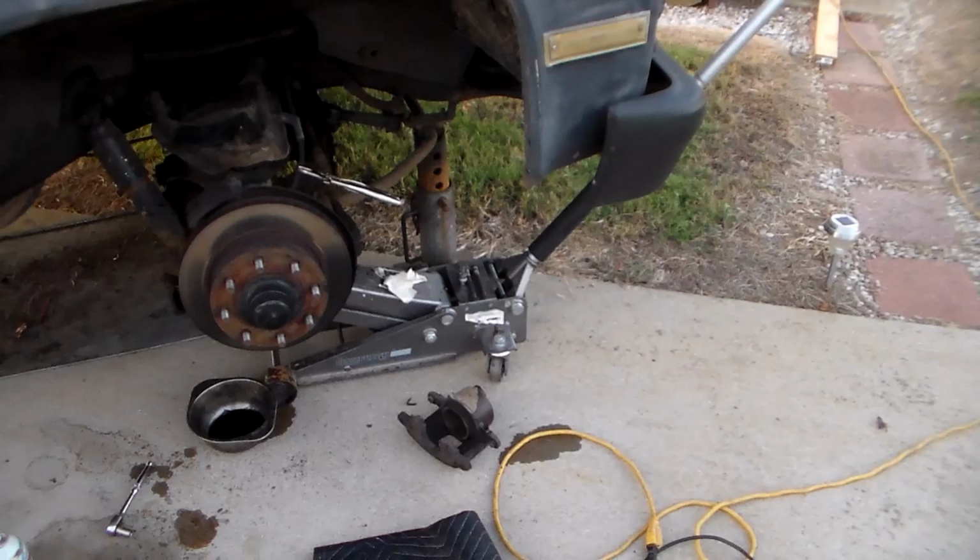As I said, I think this truck sat for a long time not running. It sat somewhere so long that the bottom of one of the gas tanks rusted out. That was before I got it. The guy that I got it from said that he had to replace one of the gas tanks because it was rusted out. It's just typical when you've got an old truck: anything that's got fluid in it, with the possible exception of the oiling system, like cooling or brakes or fuel, you're just going to have to go through and start replacing stuff, because if it doesn't fail right away, it's going to.